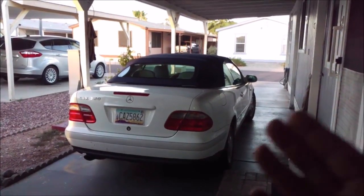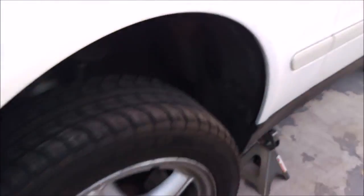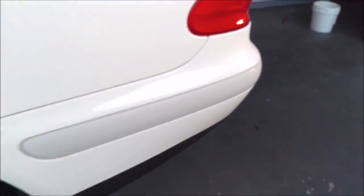So first, let's get this car up on jack stands, safe and secured. Okay, now since we have the car on jack stands all around, and we have the jack as an extra protective measure, there's a small gap between it and the car. That is good enough. Jack stands over here, and the other side as well. Now before you go under, we should give the car a good shake and make sure it's not going anywhere, not moving. Now we can go underneath the car.